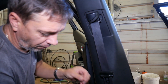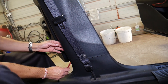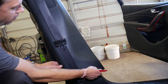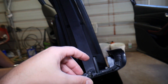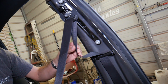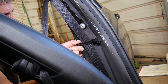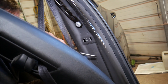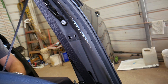Now we should just have a few clips holding that piece in place — the two pieces should fall apart. If you don't have enough room you may need to remove the seat, but I think you can do it without removing the seat. This piece slides right here, and this is where the seat belt attaches on top. That's the whole bracket — you can see it has two bolts on it. We have two clips that come loose; they can sometimes break, so you may need to replace that piece if it breaks.